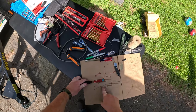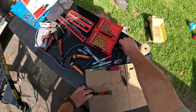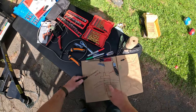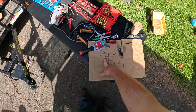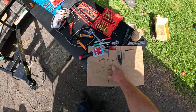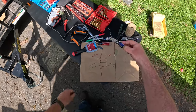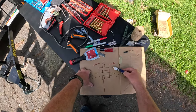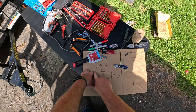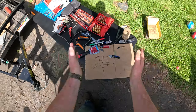And that protected the factory wiring harness from my razor blade shenanigans. And I just came down and cut that lift off. That allowed me to pass the wire through there. For the inner wire, the inner sheath, whatever, the inner cover, I had to go in there with this little guy and make a bunch of slices into the little wire grommet thing to allow the wire to go through. That eventually let me pass the wire through.